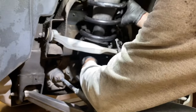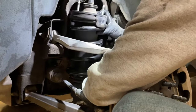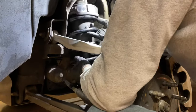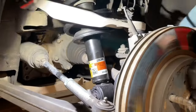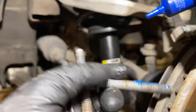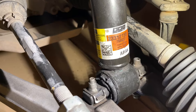Now we're going to bring in our new strut. We're just going to come right back through the top the same way we took it out. As soon as we get it angled in, we're going to go back up to the top, feed the electrical connector through the hole, and line up the three holes. It helps to push down on the wheel to slide the shock absorber into place. Get it lined up at the bottom, then put the two 15mm bolts back through with a nice bead of Loctite so they don't come loose, and drive them up through the bottom.